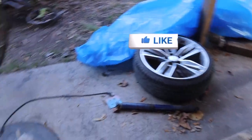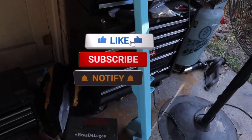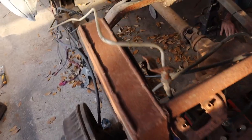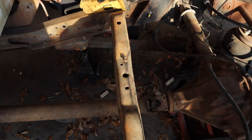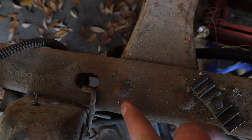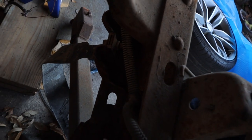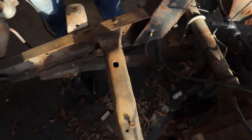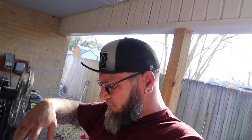We're back at it on the slow noma. Today we're going to get the raised gas tank cross member installed, which is also our wishbone cross member for the Thorbec kit. It goes in the stock location of the stock gas tank cross member. You've got to grind out the rivets — there's two at the bottom and two on top. The best thing to do is just cut the tops off with a grinder and then punch them out.